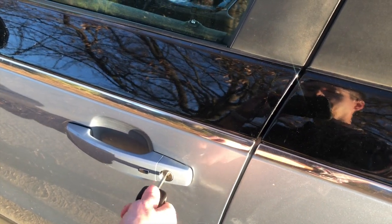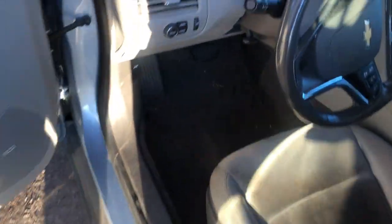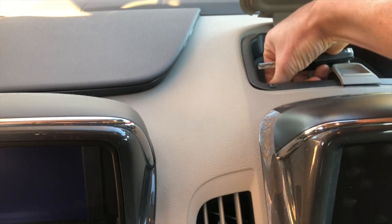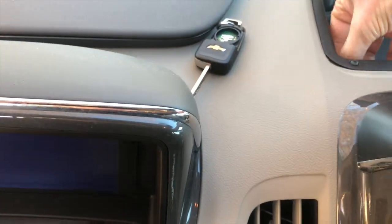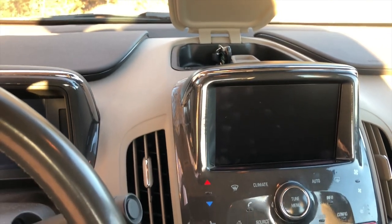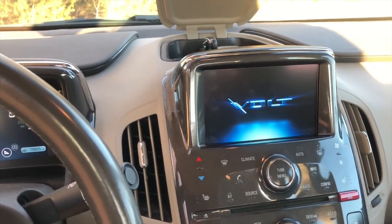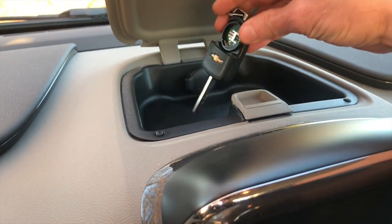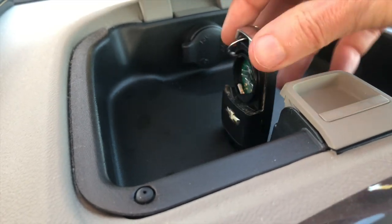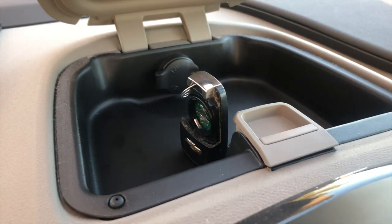But I have this key that I can use to unlock the car. Now, what's going to happen when I open the door? It starts panicking — the alarm goes off. In order to deal with that, I placed the key without the battery into this little hole. It doesn't fit perfectly; it simply falls down into that void. And that tells the car it's okay to start.